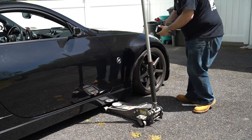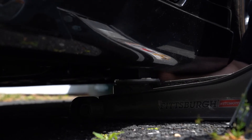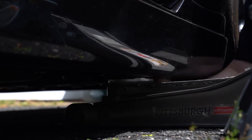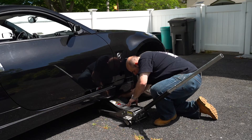To get started, the first thing we want to do is take a jack to the car. We're going to use this trusty pinch weld block to make sure that we are supporting the rocker and the inner rocker, and also to make sure that we don't damage the pinch welds. Go ahead and jack up the vehicle and place a jack stand underneath to make sure the car is well supported.